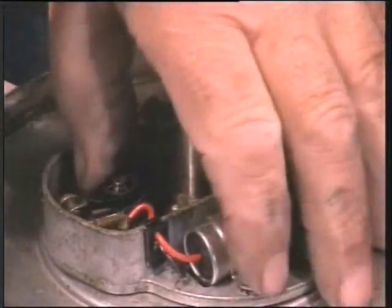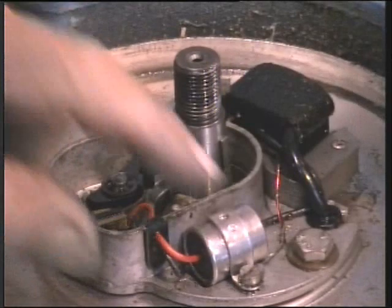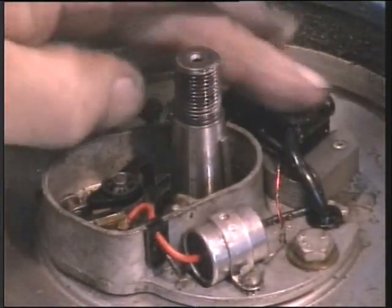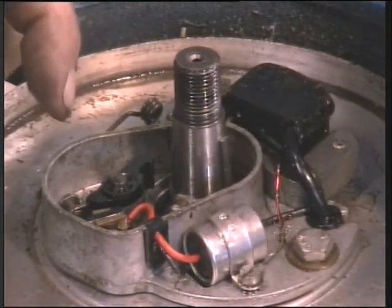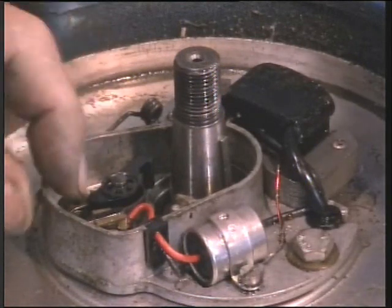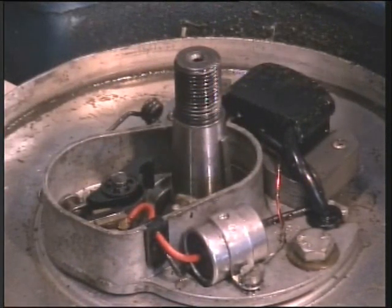Are they pitted? No, could do with a clean up — they're not pitted. If the points are pitted it's a good sign that the capacitor is open circuit. Capacitors do one of two things: they go leaky, open circuit, or short circuit. As we've got something of a spark I can rule out the actual coil, unless it's gone short of turns which I don't think so. So I'm going to put a meter on the condenser. There's no evidence of sparking so I'll clean up the points and generally clean round. Put the flywheel back on and we'll see if we've got a decent spark, yes or no.